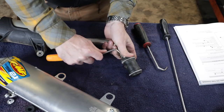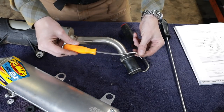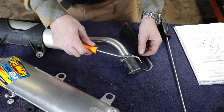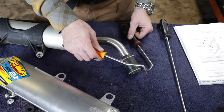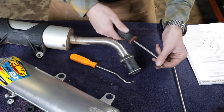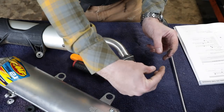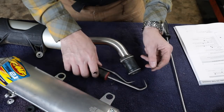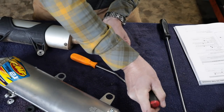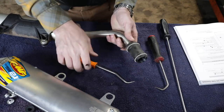This clamp is really clever — it doesn't have any fasteners, just spring tension. I used to own a wrecking yard so I took apart lots of vehicles and acquired tools from that experience. One of my favorites is this little pick — maybe an O-ring pick — this one from Snap-on is great. And this one here is made for pulling radiator hoses or heater core hoses when the rubber is stuck up against the nipple by the firewall. You hook it underneath and work it back and forth to break the seal, then pull it off. That has saved me countless hours.